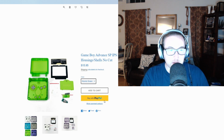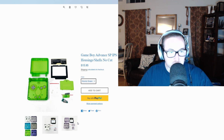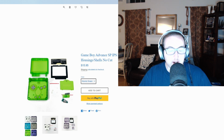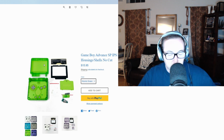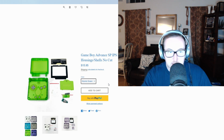So again, here, this is where you have all the freedom. Just go out and buy any housing that you want, any color. Some are glow in the dark, some are see-through. I put a couple examples in the description if you're looking for some fancier ones or with a cool paint job, etc. Some of them also have no cut or IPS ready, meaning you can literally just throw an IPS screen in here, no issues. Some of the normal cases that you'll have, this upper part, and I'll show you later that there is a portion of plastic you need to cut in order for the larger IPS screen to fit in this upper housing. Not a big deal. You take a knife, you cut it for a couple seconds, a couple minutes, and you're done.